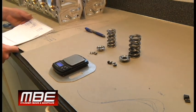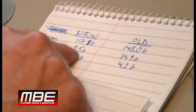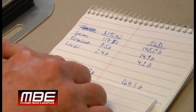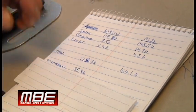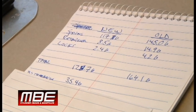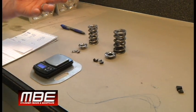So here you are — old versus new. When you total that up, you get 128.7 grams new versus 164.1 grams old. The difference is 35.4 grams. When we're worried about valve weights and trying to keep valve weights within two or three grams to control this, would you ever put 35 grams on your valve? That would be like welding Mallory to the valve — that's crazy. You wouldn't do that, but you will do this.